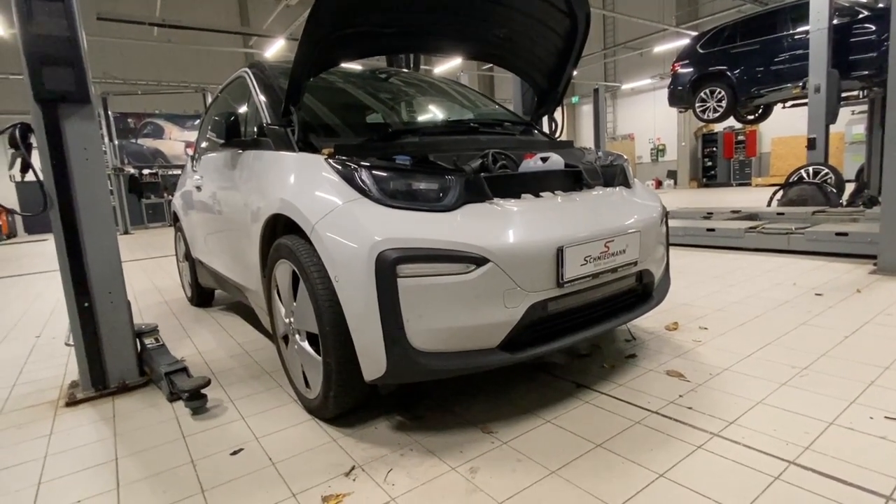You're all lucky because I'll switch to the front camera. I'm going to have a wash, tidy my tools away, and then go home. Don't worry about that 8 Series 850 — there's a reason it's like that. The 8 Series' suspension has been sent away to Power, the only company in the world who can rebuild original EDC suspension. It's worth thousands and you can't even buy them anymore, so other than coilovers, rebuilding the originals is the way to go. We can't leave a ramp out of action just for one car — that's potentially thousands of pounds a week.